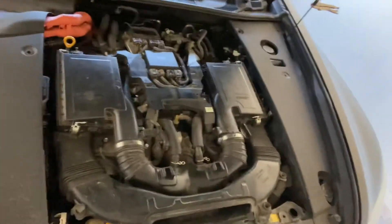This is a high mileage LS 600, so I put the motor flush in it and I'll show you how to do that. I'm also using high mileage oil and changing the filter, making sure it's all done right. I'll also be making a video later on about how to change the spark plugs on this, because dealerships usually charge about $2,000 for labor on this car — it's really hard to work on.